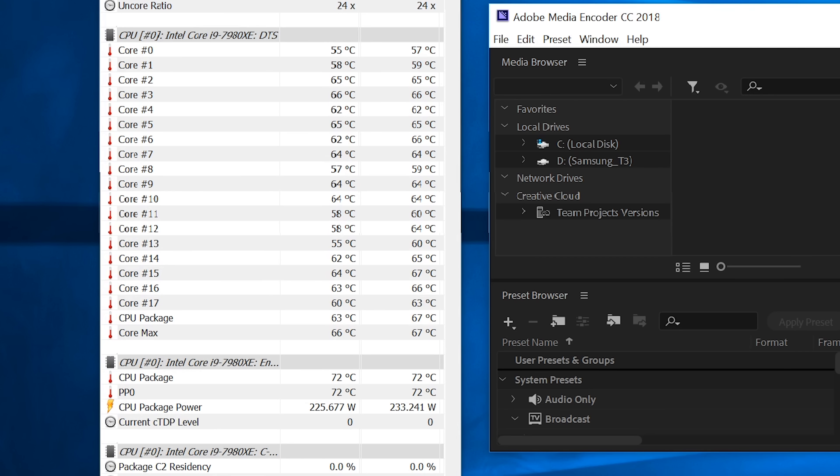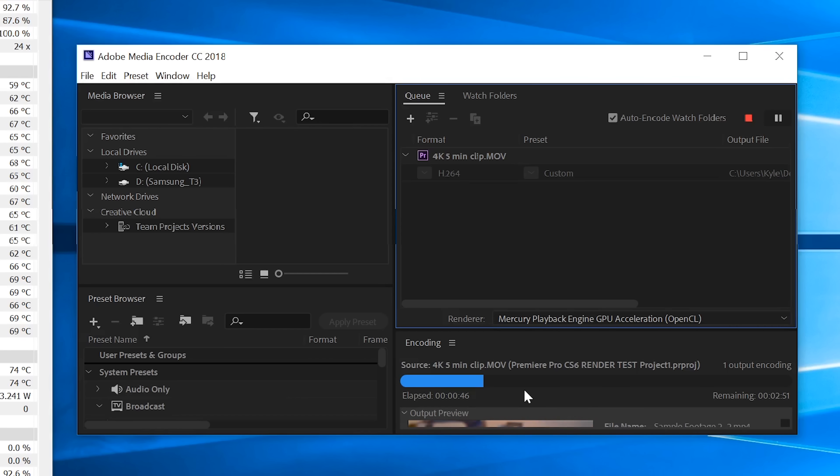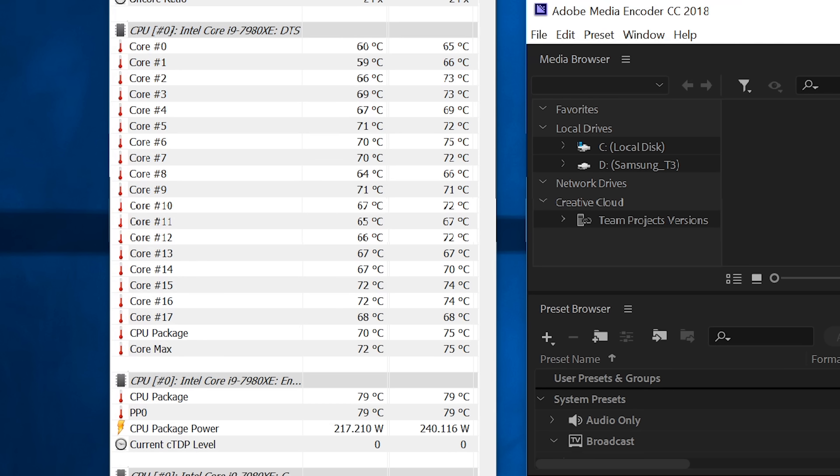Right now things are looking pretty good. With Adobe Media Encoder it doesn't immediately put a full load on the system until maybe a quarter of the way through — and especially half the way through is about as hot as the CPU will ever get, at least in my experience. Right now we're spiking up to around 68 to 69 degrees. We're actually clocking at four gigahertz — that's right on the money. And also the render is going a lot faster this time, which means we're not thermal throttling. This five-minute clip took over 10 minutes to render before the delidding. The CPU is not overclocked — we're running bone stock, being cooled by a 360mm Thermaltake Ring Plus. We're already more than halfway through the render, hovering at around 80 degrees C.